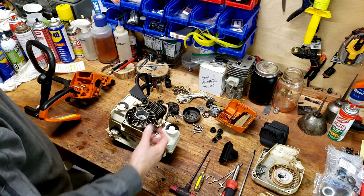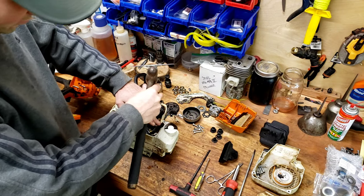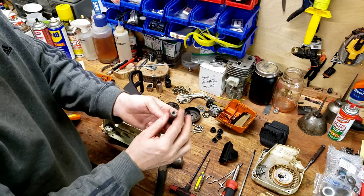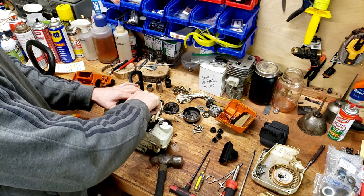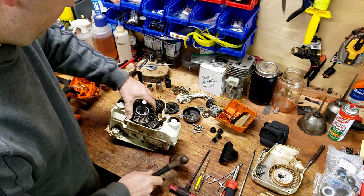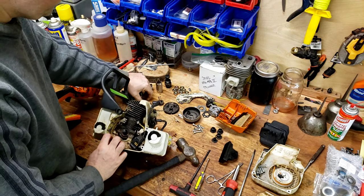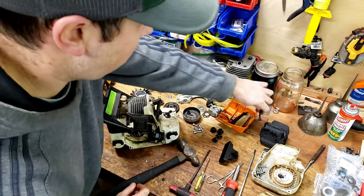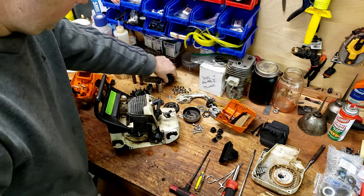It's up to you to pick your favorite style of flywheel removal. You can use a puller, a small drift that fits in the end — support it, give it a crack, and it works. I've mentioned in other videos I just make these little knockers with the right-size thread for the crankshaft, throw them all the way on there, and pull the flywheel off. I find that's about the easiest method. By all means, if there are provisions to use a proper puller, that's obviously your best bet, but there are a lot of other ways that work.